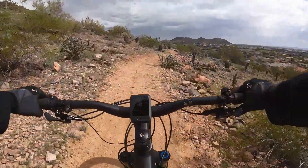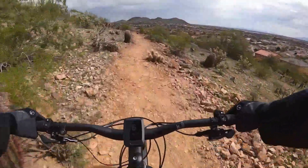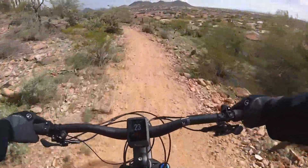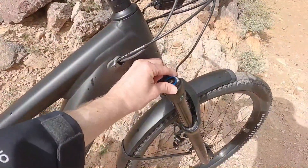I'm riding around here, just having a blast and it's very comfortable. Both suspension elements are air, so you can sag them down to your body weight. 35 millimeter stanchions up here — love the black anodized look. And they also have, in this case, a clicker for compression, so a lot of adjustability there.